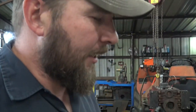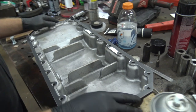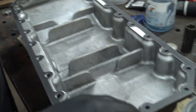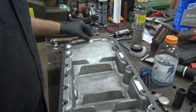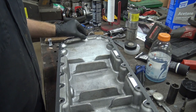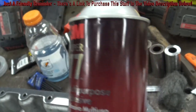Today's tech tip is about Super 77. Whenever you're dealing with gaskets on flange surfaces like an oil pan, water pump, or anything that uses a gasket material, it's a big pain to crawl underneath and line the gasket up. Some people use RTV, but I don't like that because wet RTV still lets the gasket move around. So what I use is Super 77 multi-purpose adhesive — it's like a contact adhesive spray.